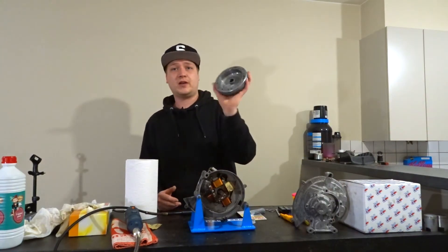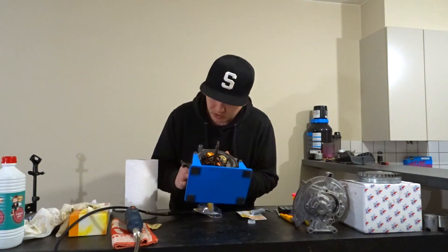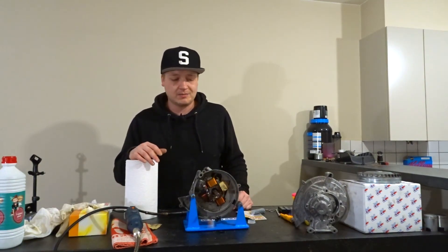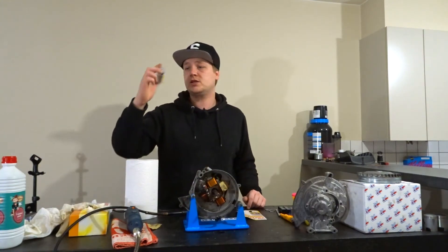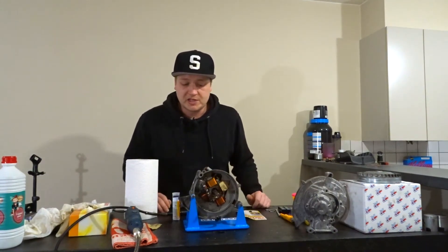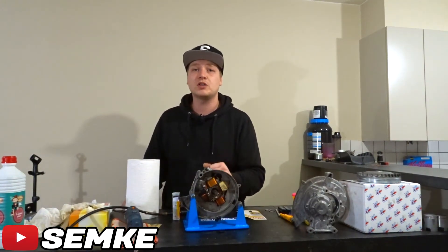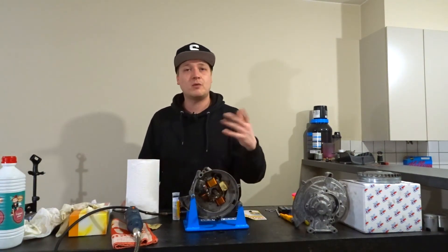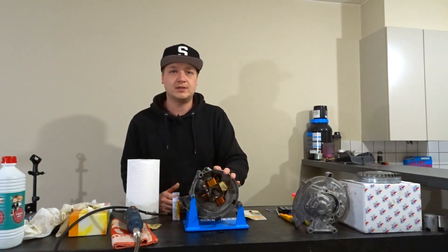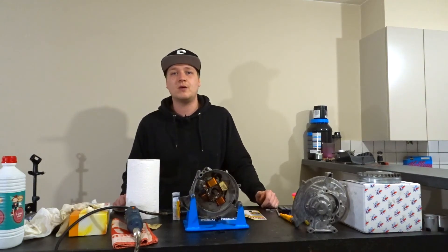So the hole is fixed. Now I still need to know if I can put this back on. I'm probably gonna need to do some grinding. But for now it looks pretty good. I got a good coverage of this part, so I'm happy with it. Also the inside I'm gonna have to grind out to make it better flowing, not go as crazy as I did before. So this is my first experience working with this Loctite EA3463. I'm hoping it works because I don't want to buy another crankcase. But we will see if it works — it's all an experiment. Now because I want it to be as hard as possible, I'm gonna let it dry. I will keep you posted on Instagram with pictures. So I'm gonna let this dry, give it time to cure, and we will continue this on a later date. That's gonna be it for this video guys. Hope you enjoyed it. Be sure to leave a like and a comment down below. Follow me on Facebook, Twitter and on Instagram. And I will see you in the next one.